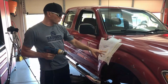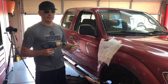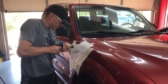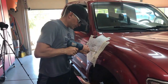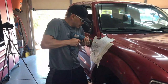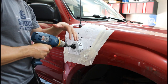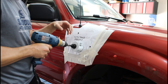I'm going to pre-drill all the penetrations with a small drill bit. I have my sunglasses on because I couldn't find my goggles — not a necessity, but since we only have one set of eyes, protect yourself. Give it a little reverse and then go forward with the hole saw. The saw is going quickly so it's a little aggressive.